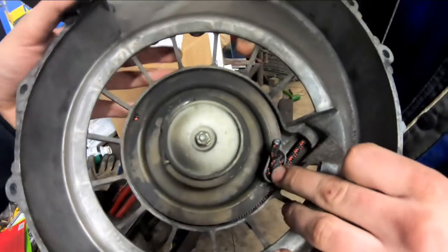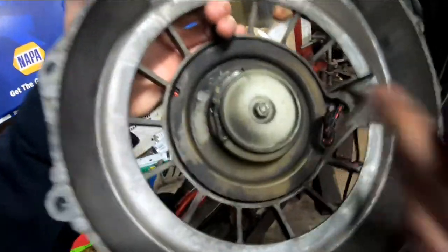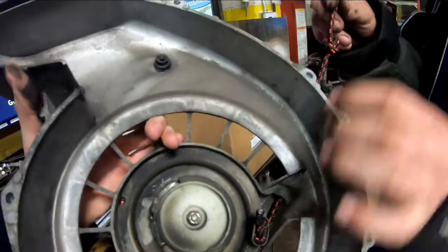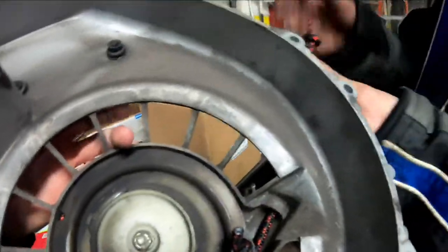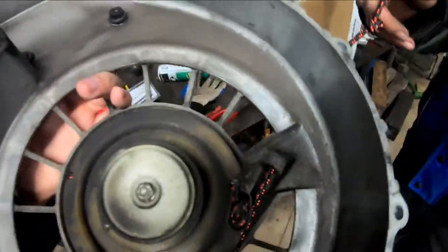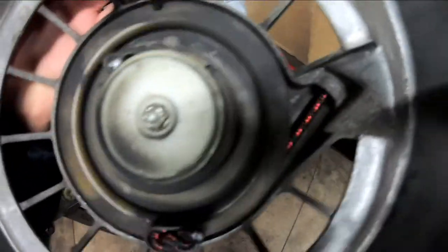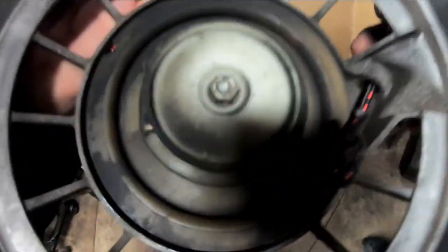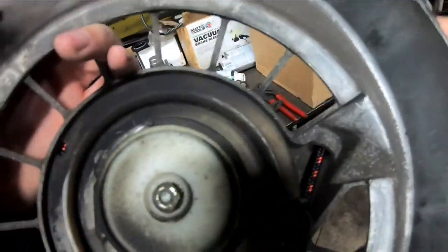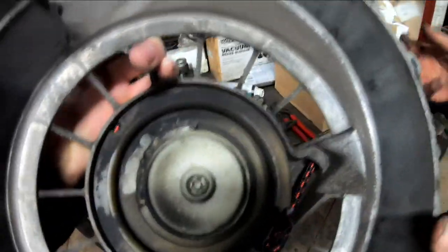We basically just tucked the knot down in the channel and let the little tail hang out, because it should sit inside the cuff and it shouldn't really hurt anything. I tied a little safety knot because we're gonna put this back on the machine — this obviously hooks to your recoil handle. Always tie a little quick one just in case it would pull through; you don't want to redo all your work. That's basically it. You can check for operation — the dog kicks out, it's got good spring recoil. A good rule of thumb is you can always brake-clean it out and then put some good lubricant spray to get everything lubricated, but this one is in quite good shape so we're just gonna leave it as is.